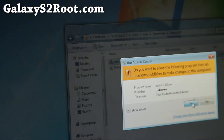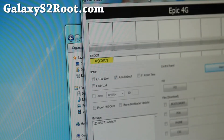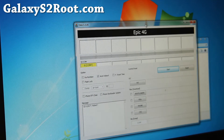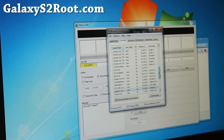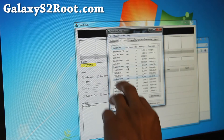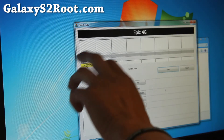You should get some kind of connection sign here. If you don't get this, you don't have drivers installed — simply download Samsung KIES, I'll have download links for that, run it, then unplug your phone and plug it back in. You should get that yellow indicator. Also, if you're having trouble even with KIES installed, go to Task Manager and kill any processes that start with KIES.